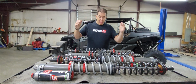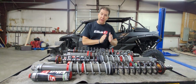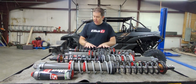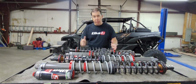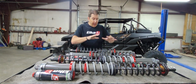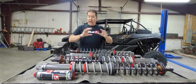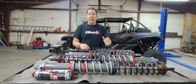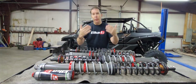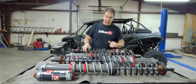extremely high quality. You have lots of preload adjustment. You have crossover so you can fine tune where your tender spring bottoms out, where the change in rate comes at what point in the stroke. You have all these clickers to fine tune. It's just absolutely amazing. When you have a shock that has this much tunability, it's limitless for every type of terrain, every type of driver. It doesn't matter. We can tune for absolute race perfection. If you're racing a KRX, you want to get our shocks. It's guaranteed. I will drop lap time off of your racing with our suspension.